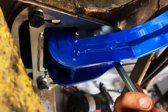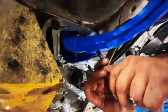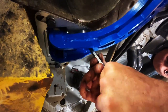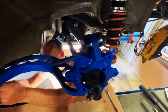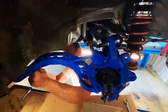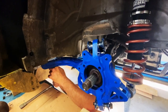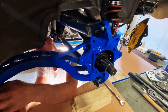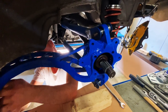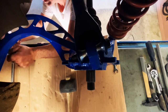The quick adjuster for the toe is what everybody talks about — because the spherical is a lot more compact, it gives a lot more movement and you have way more reach in the toe of the car. With a number 10 Allen male — we prefer to use a ball head — you can adjust it really quickly and really accurately. It's a little bit difficult to see without a wheel or rotor on there, but you can definitely see it moving. These E36/E46 chassis really fly if you toe them in, but sometimes it can be a little too much, so being able to adjust it easily is great.